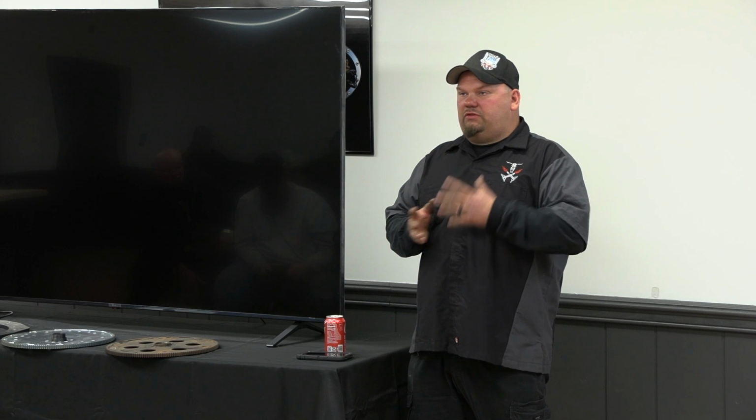Two things I would do, and what I do for my customers. Of any engine that comes to me, two things. Do you know it was running? And if it's what I call a good runner, a good core, it didn't have any valve train issues, wasn't run out of oil. We do two things. The oil pumps are problematic, so we put a new oil pump in every engine.